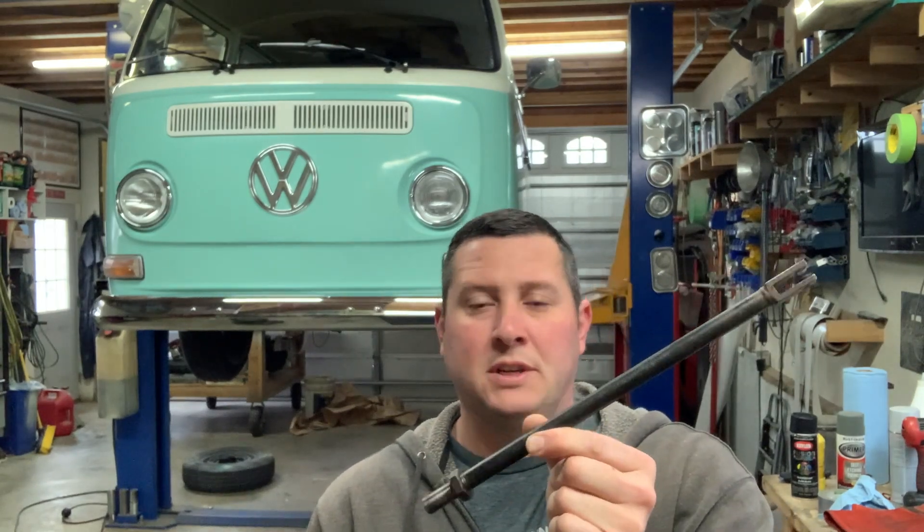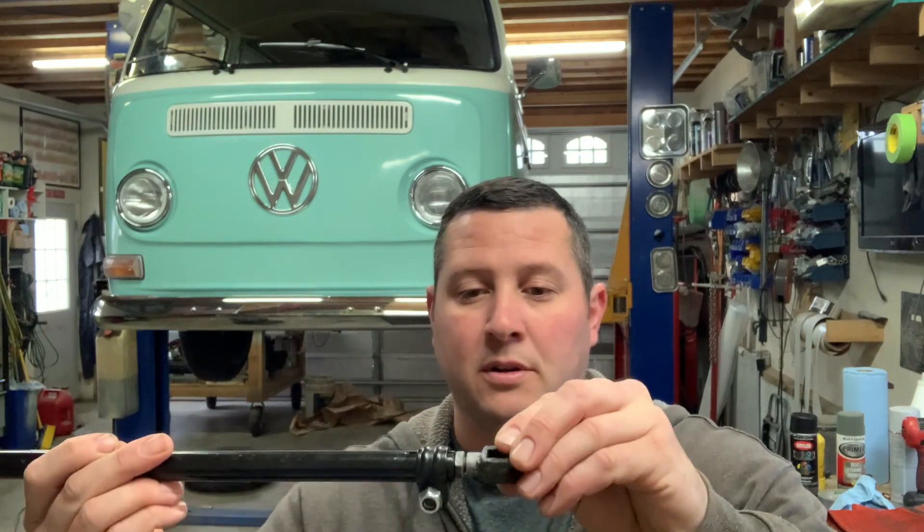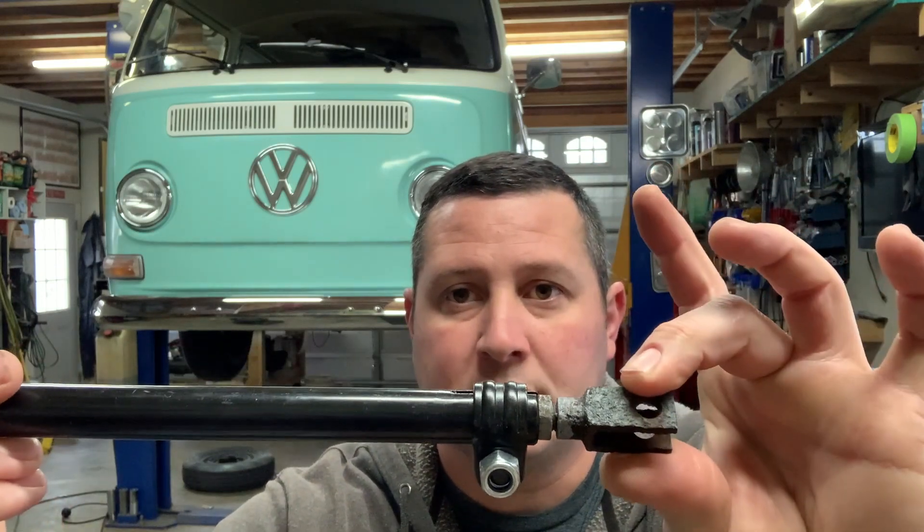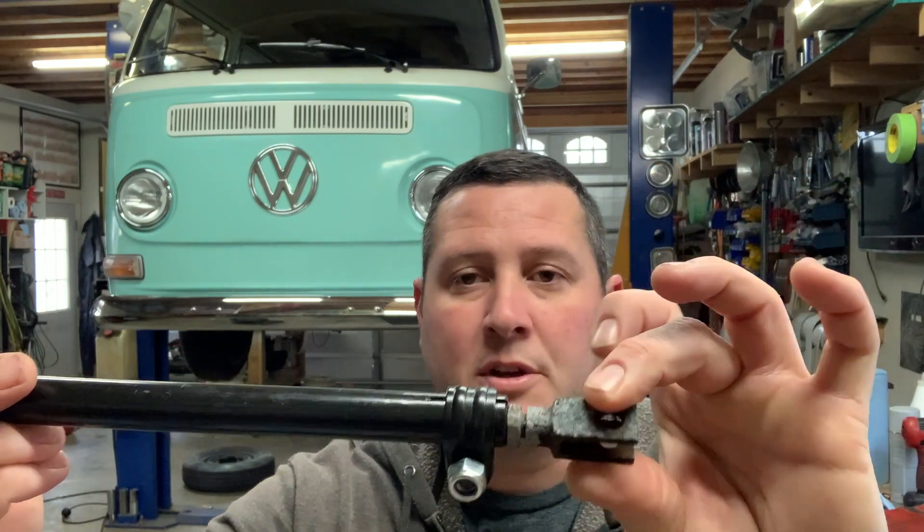I really wanted to share this because it took me a long time — I had to actually buy this from somebody out in Washington and it took forever to show up, so I've been kind of on hold to actually finish the system and bleed the brakes. If I'd known this little trick, this thing would have been done already. I'll do a quick video on how I'm going to build it, which is just cutting a few inches of thread off the old tie rod end. I'm going to weld the nut to the sleeve itself after I cut it to length, which also gives me another adjustment point.